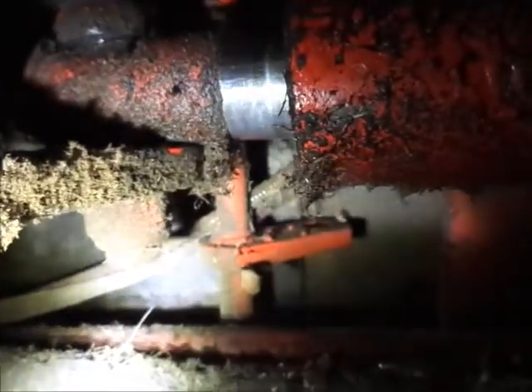The other thing is it would appear like it's hitting the shift plate. I can't see exactly what's hitting what — I'm assuming it's the pins up in here by the frame. I might take the shifter plate off and work on this instead of from down below, but I'm trying not to take too much apart. I stumbled across the steering problem, so I figured I'd show you guys. The reverse side rod also rattles around when forward is engaged, so I'm going to put a bolt through that instead of a pin.